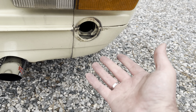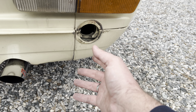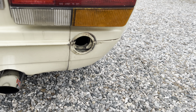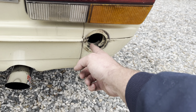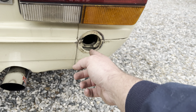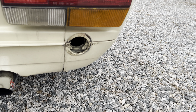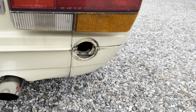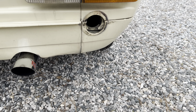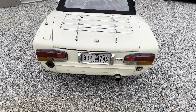As far as being an actual bumper, these bumperettes don't do much of anything. The $400 Abarth bumperettes don't do anything either, because the way you have to mount them even on the early cars is a thin piece of metal — even if you have chrome bumpers. People say you can't take bumpers off without putting bumperettes on, but they still don't give you any rigidity. Some people use a piece of unistrut or pipe and mount the bumperette on that — still not strong enough to protect you in an accident. This is literally just for looks.